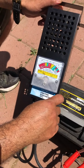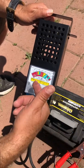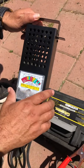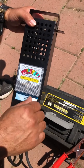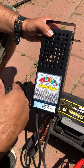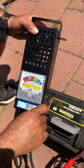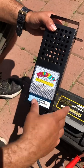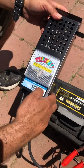It's not holding anything, so this battery is no good — I know that for a fact. It stayed at 10 volts, so I've got to replace the battery. I know this product works because I tested it on both batteries on my other cars and it worked perfectly. The other ones were holding a charge at over 11 volts. It's not even reaching the cranking power — it's at 10 — so the battery is no good.